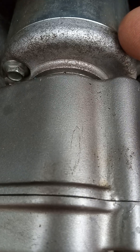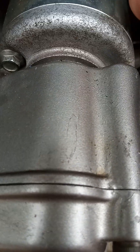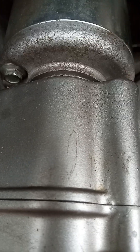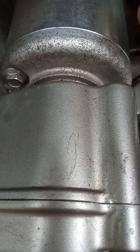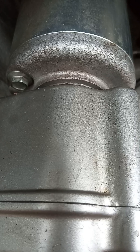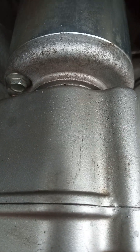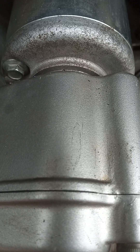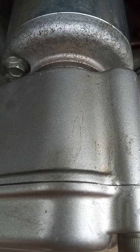What happened was we put it back together again and the motor was really great — we cleaned it out, cleaned the four carbon brushes in it and everything, which was really great — but the thing turned backwards. It was supposed to turn anti-clockwise and was turning clockwise on the spindle inside. So we thought, what's going wrong here?